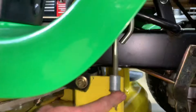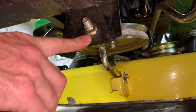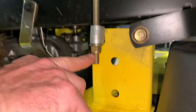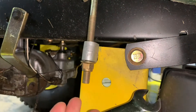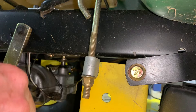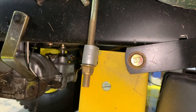So we have an adjuster here. You have your front adjuster, which is right here. These are 15 millimeter wrench — I'm going to make sure. Yes, 15 millimeter is exactly it. And then we have the other adjuster on the other side. When you do level the mower deck, you want to make sure that side to side — the adjustments on each side of the mower are even. This front one will do the front to back. Normally the mowers sit a little bit higher than this when brought all the way up to the highest position.